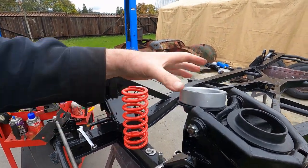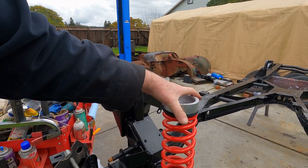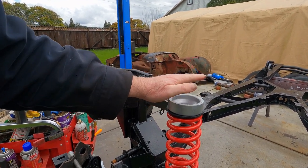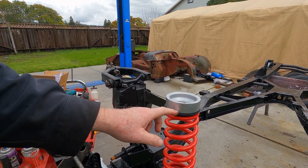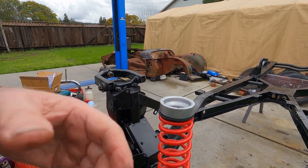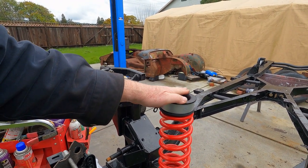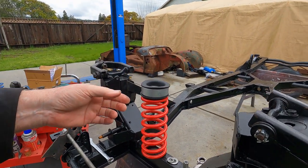Because this is a TR2, the early cars, up to the change in TR4s somewhere in the first few thousand, use a shorter spring and a spacer, and the factory says to use just rubber here and there, which is quite practical, but I like to add another one here. Just a little bit more noise isolation. I suppose it picks up the ride height some small amount, but I'm not really worried about that.